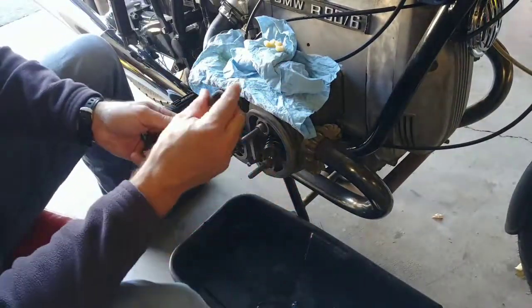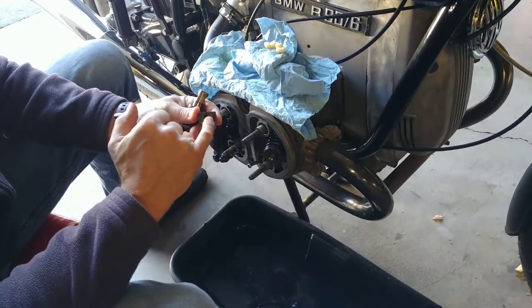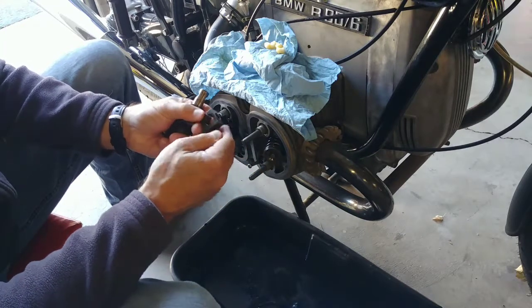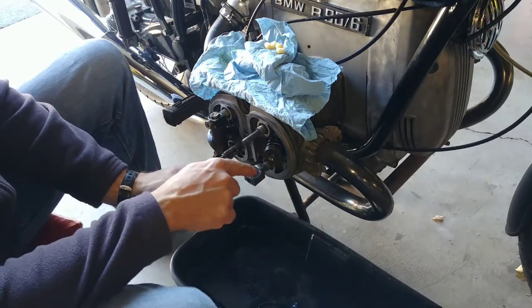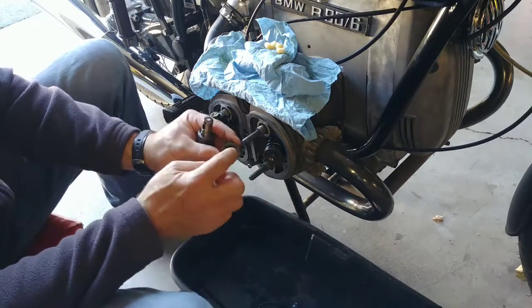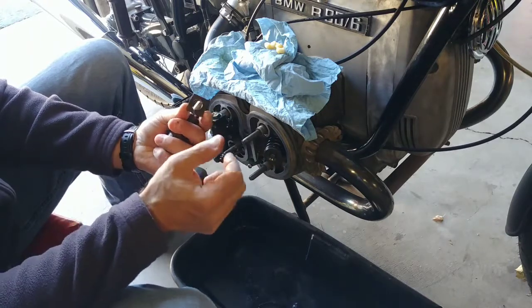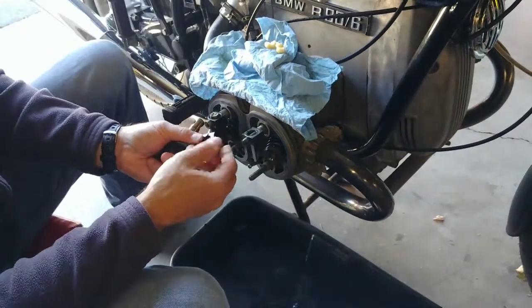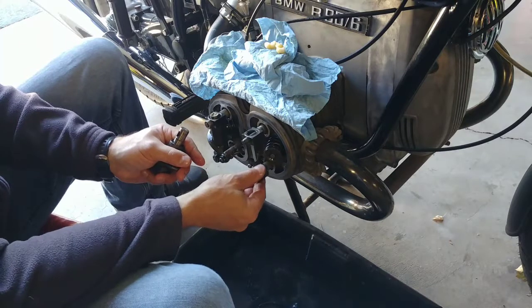And then behind you, sorry, in the way, there are the blocks. They have an inside and an outside. Here's a little step machined into this block. That's the outside. And here in my case, I actually have turned the blocks around. So this one used to be the bottom one. You can see the worn surface from the motion of the rocker. You can see that here. And the other side is clean of any marring or surface damage. So now I put this one at the top, so I have a clean, fresh surface. And did the same thing. So this one here, no, this way, used to be the top one like that, and now it's going to be the bottom one.